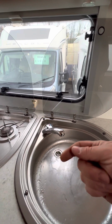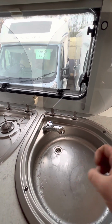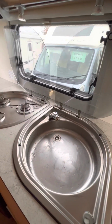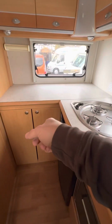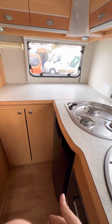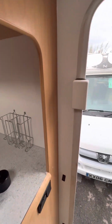If when you pull that tap up on the hot side with the pump on, no water comes out from there and it kind of coughs and splutters, it either means one of two things. It either means there's not enough water in your fresh tank, or that drain tap down there is down, and all the water is just draining out straight underneath the vehicle. All right, but you need to do that. Just double check basically that the boiler's full before you try and light it up.